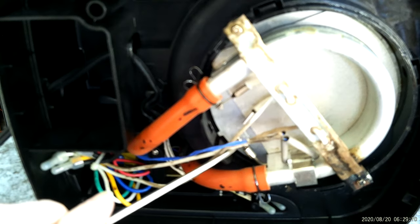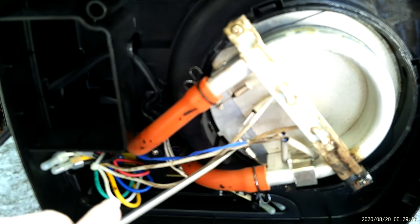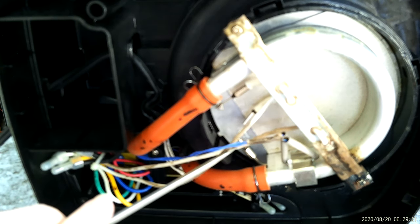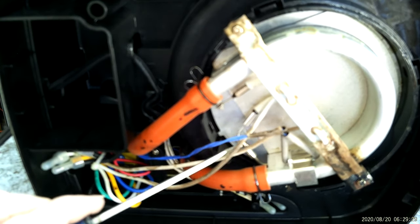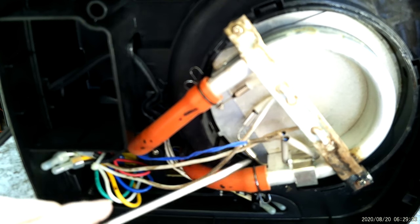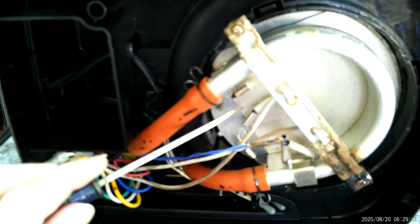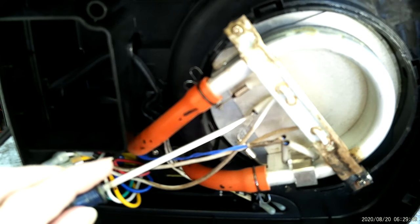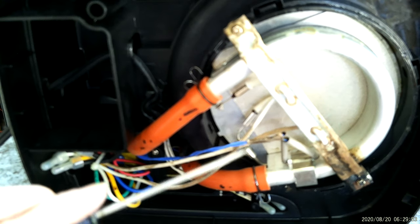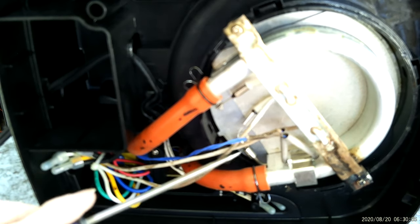I was looking online — it's been a long time since I did any studying on it, looking at how people say to replace them. This fuse I put in is rated at 333 degrees Fahrenheit. They're actually rated in Celsius. The thing is, a lot of electronic solder could possibly melt before this fuse blows. So if your connectors fall loose, you still have one side connected to your 110-volt input. That's why I used crimp connectors — they're like wire nuts but crimped.